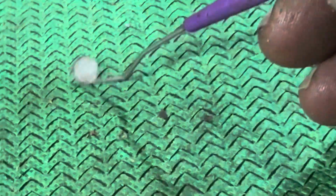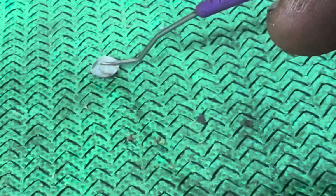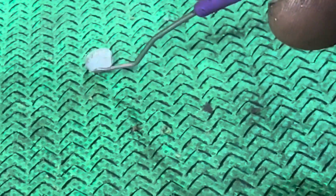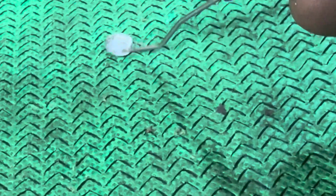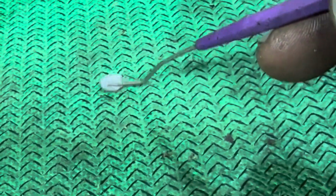What I found is she's actually full of what looks like metal shavings. I'm betting from during the build they didn't clean the saw very well, and the inlet screen is full of metal-like shavings. So that was probably causing the lean condition of the saw, and I almost didn't see it.